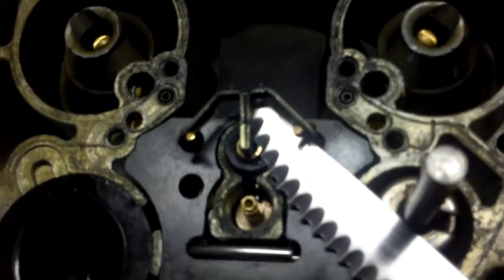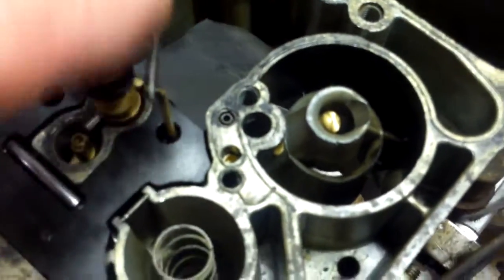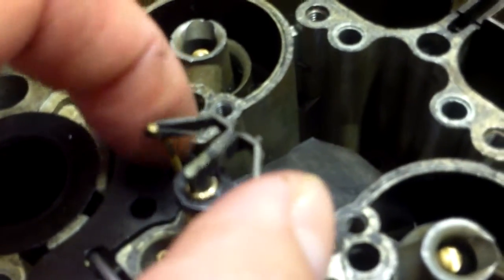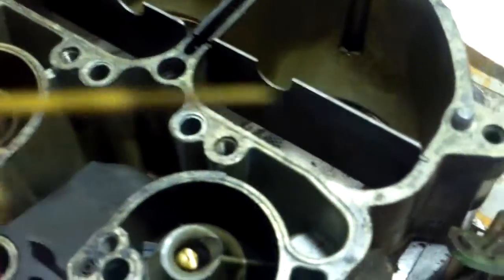Seating the primary metering rods upon reassembly can be frustrating — the thing goes up. I'll try and show you a little bit. Go ahead and unseat it. Take out the accelerator pump. Watch — I'm going to let it go up now. So now it's up. You can see the piston is out of its bore, but it doesn't go directly down. So you have to wiggle it around a little bit, and sometimes it'll take you several minutes. Be very patient, be very careful, because again, these little needle metering rods are very, very delicate. If you jam down on these things and push down on them, you will break them — even if you bend them a little bit, that's it. You have to get a new set. So don't do that.